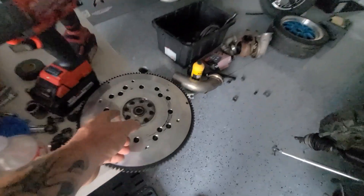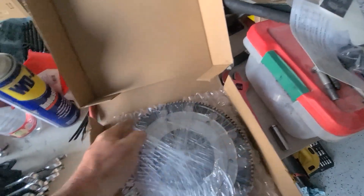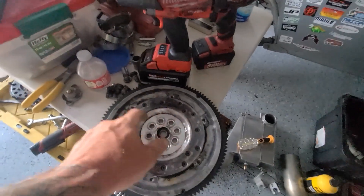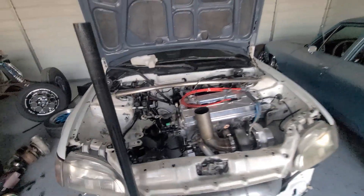This one should stand off differently than this one. I can actually feel it - the depth - and the steel flywheel is a lot deeper. Right here there's not much - there's a spacer that goes on here and I don't know where it went. We got a new flywheel. They use a steel one now. I can still use the old flywheel if I find the spacer for it, and the reason I like the old one is because it's all replaceable - Clutch Masters still sells those pieces. Tomorrow we're going to get the new flywheel and clutch put back in, get the transmission in, and get back together so we can still make race week.